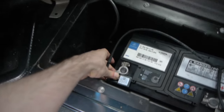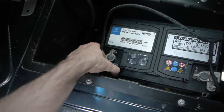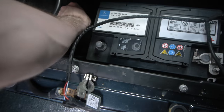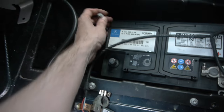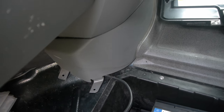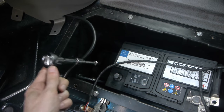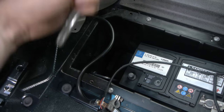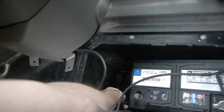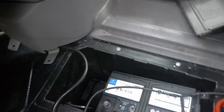This is how I remove this bit — I loosen that like I was doing earlier, and then when you do that you just remove it. The battery still doesn't come out, so you've got to take these clamp bolts out. I've already loosened these — they're really long bolts and you need an extension to get enough leverage to twist it around. It's quite annoying without one.